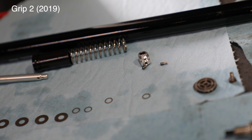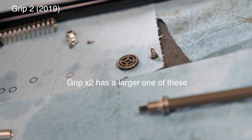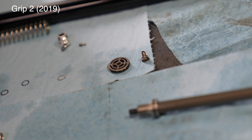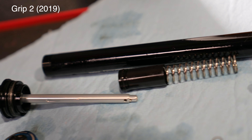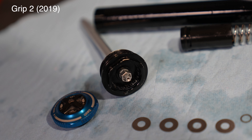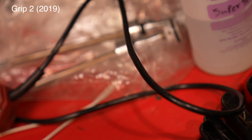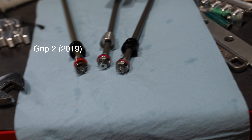Now let's look at the grip 2 damper — this is actually the original grip 2 damper from 2019, so it has like 14 clicks of high-speed compression. It has a massive range in compression compared to the newer VCC grip 2 dampers. Underneath the top cap on the grip 2 damper, we have the same spring-backed IFP as the normal grip, and we do have some extra shims. There's also a whole bunch of more sophisticated oil control valves inside of the grip 2 damper, but all three forks share the same base valve piston.